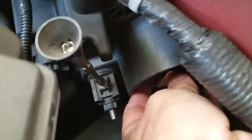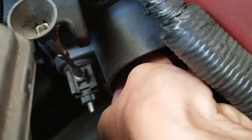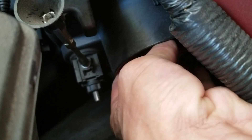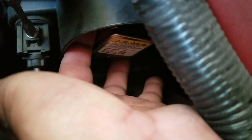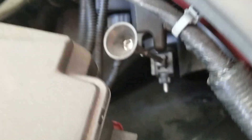The passenger side went in pretty good — I did it all with my left hand. I pushed and held it straight using all four fingers and a thumb, pushed it straight in until it felt solid. Then I used two fingers to hold it and put my thumb on top of the ballast/igniter and my index finger on the lever for the round locking ring — spun it about a quarter turn. Check that it's good and tight, then put the cover back on.